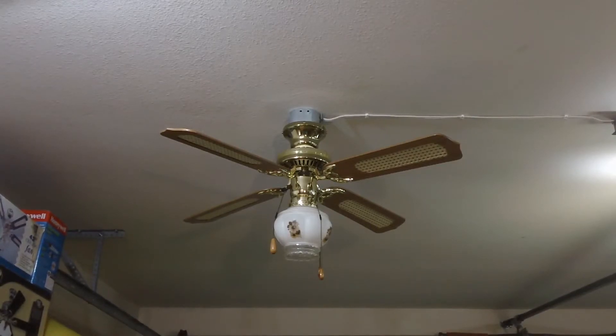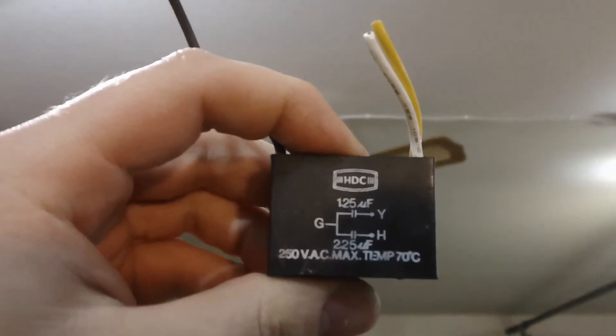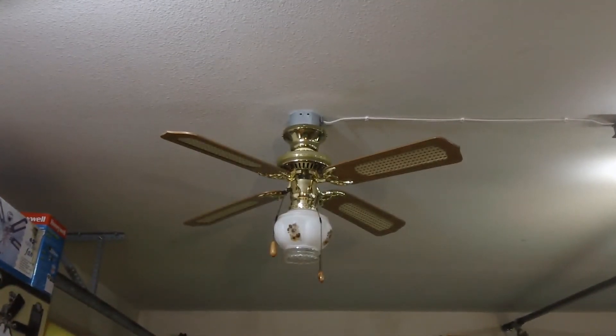Although slightly large for the fan, it does look surprisingly decent, especially up close. Unfortunately, the fan's main information sticker was removed at some point during its lifetime. However, the Nader logo is still clearly visible on the switch housing. The original capacitor on the fan was actually causing the motor to spin rather slowly. Being that this is a 42 inch fan, and the values are 1.25 microfarads and 2.25 microfarads, it's no surprise that this was the case, and therefore I decided to switch it out for a capacitor of higher values.